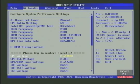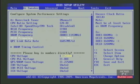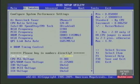It wasn't until we increased the CPU voltage to 1.25 volts that the overclock became stable. The QPI DRAM voltage increase wasn't needed because of the low RAM and uncore frequencies. If you have 1600 MHz RAM, continue to follow along as if you have 1333 MHz RAM — we will address 1600 MHz RAM later in this lesson. We are going to leave the CPU PLL voltage and the QPI DRAM voltage where they are, and increase the CPU voltage to 1.275 volts. I'll press F10 and enter to save and exit.